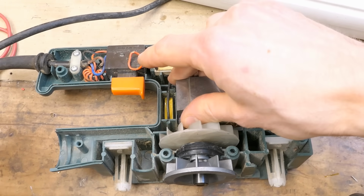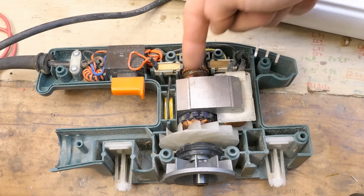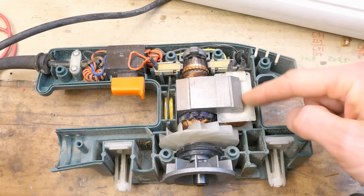The rotor coils are actually not hot, this one is. But it can easily be the other way, the hot one is the good one. And this coil is in series with these coils, so if these are shorted, you have way more voltage on this one, which is getting hot then. More voltage also means more current in it.